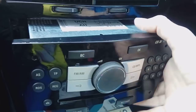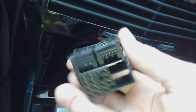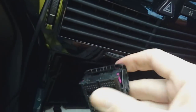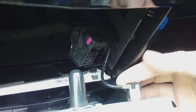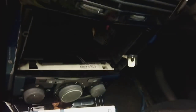Once you've pulled it forward, you've got a quad lock connector on the back. Squeeze the tabs together and pull — that's locked around, squeeze the tabs, pull it round and open, and the connector slides out. You've also got a FAKRA aerial connector — push-on job, squeeze the tab and pull off. Take your radio out of the way.